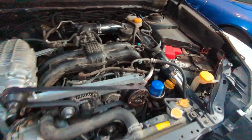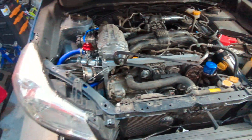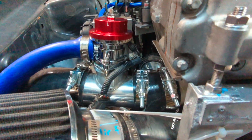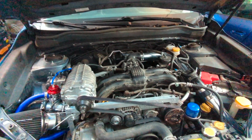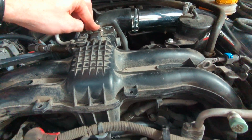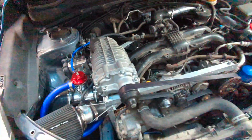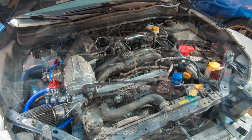The charge pipe is fully secured, both the cold side and the hot side. I plugged this little nipple at the bottom of the blow-off valve. Worth noting: some of the hoses were pretty loose on the intake manifold, and since they're never meant to see pressure, I was worried they'd pop off. So I added a hose clamp here and a hose clamp down there. This is the evap line, I believe. I think that's it.